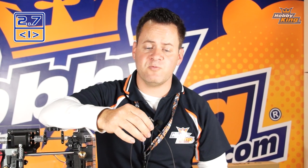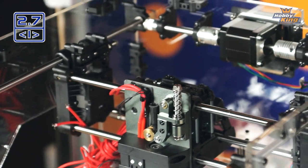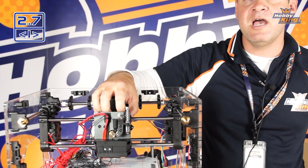There is a tightening process we'll go through. We also use the teeth to tension and lock into the system. All three belts are installed and tensioned identically, though the dual drive side requires timing to be adjusted together. The center section attachment and tension adjustment use the exact same components and blocks on both sides. I'll go into real intricate detail on the center one since visibility is good, and the process is almost identical on the outer sections.